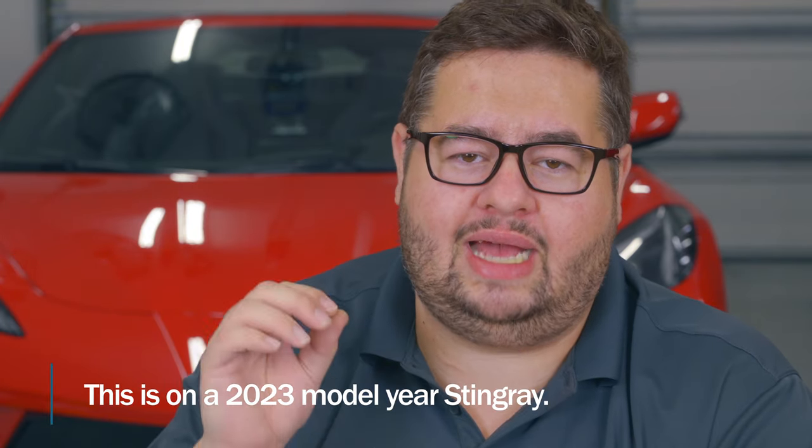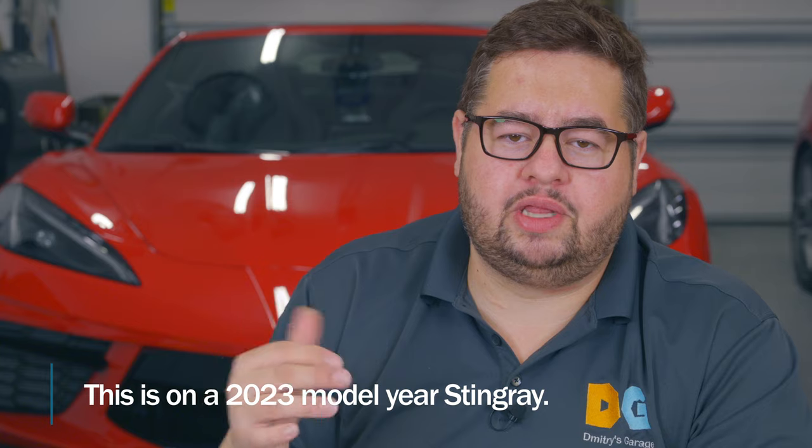Furthermore, I'll show you how to piggyback off that to install a radar detector, a dash cam, whatever you might want to wire in. Some people do believe that that is a constant on power source. However, in my testing, I found that it has about a 10-minute timeout. Whenever you open the door or start the ignition or the engine on the car, it turns power on to the visor. When you shut everything, about 10 minutes later, it all turns off. And I'm assuming that's for battery drain down protection.